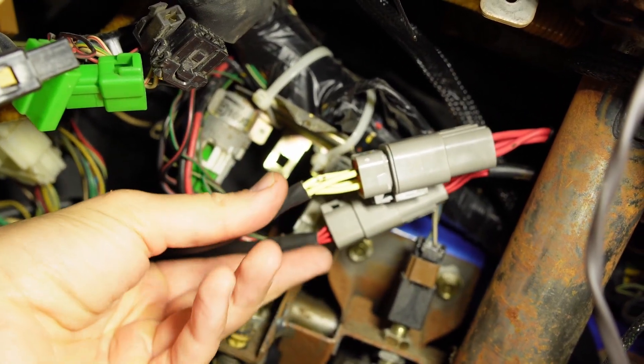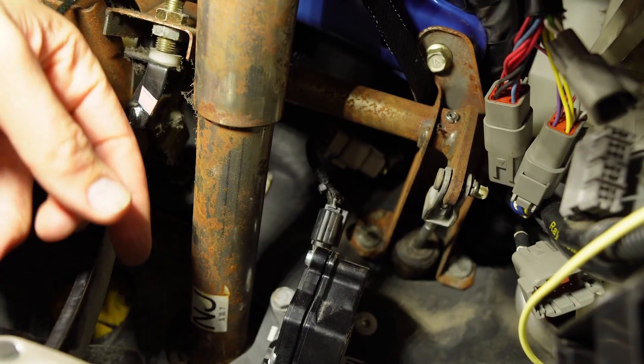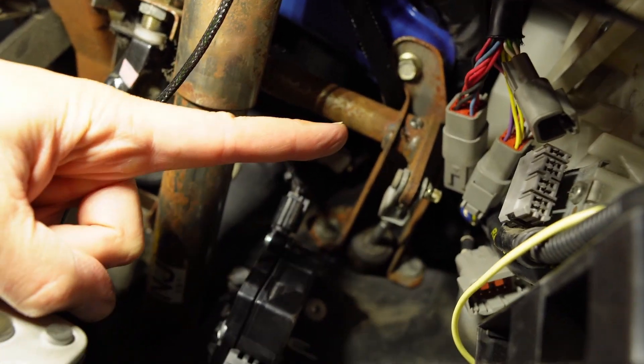From the starter motor there's another power feed going into the car and onto the PMU. We have the two connectors going behind the fender liner to the front of the car to the fuse box. The accelerator pedal connector goes to a Deutsch connector which goes to the main trunk of the harness to the bulkhead connector. More and more things are getting connected. I'll now refit all the rear seats, put the fender liner back in, put the wheel on, drop the car back on the ground, and then we can move on.